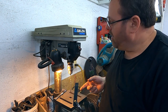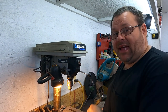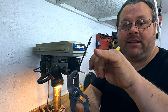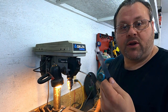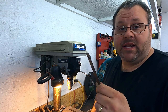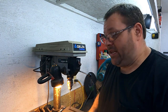There it is, folks. You'd say that bit wouldn't last any time — but no, I've used this exact bit the entire time through all of this steel. That carbide inlaid tip is just doing a friction melt through, that's all it's doing. I'll get a little cone on the back side and I'll just buff that off on the grinder real quick. I do it on both ends. I can make these just as fast as somebody with a punch.